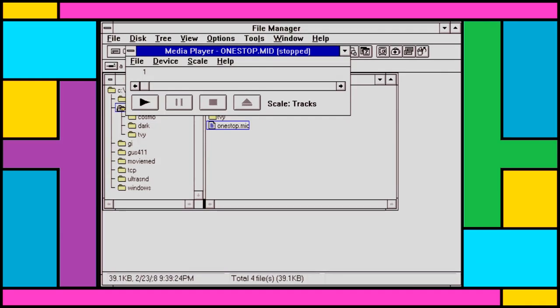The stock instruments for MIDI are a little weak. They don't have that much punch about them, but they are at least serviceable. I'd certainly rather listen to these than what you'd get on an Ensoniq card. However, it's quite possible to break this by switching to another MIDI too quickly for the instruments' loading time, which quite often stops them loading at all and causes the wrong instruments to play. I'm not sure why we can't just load all of them at once. I mean, plenty of cards could do that in 512k and actually sounded better than the Gus. But then the Gus can't handle any compression, so maybe that's why.